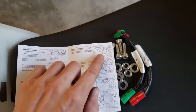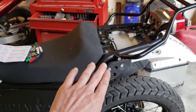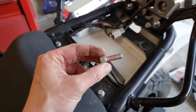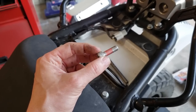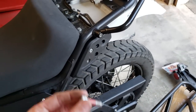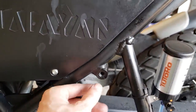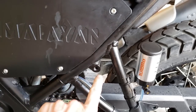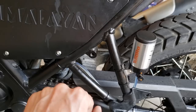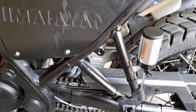Now on to the cool stuff. Pull out the bolts here and here — do yourself a favor and do one side at a time. That bolt was hard to get out because it has red Loctite thread lock on it. When you put your bolts back in, I highly recommend using thread lock — you don't want the weight of the boxes rattling bolts loose. One of the lower holes never had a bolt in it from the factory, so there's paint in the threads. Thread a bolt in and out several times to cut through that paint before final installation — it'll be much easier.